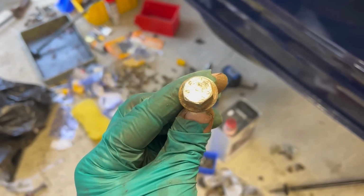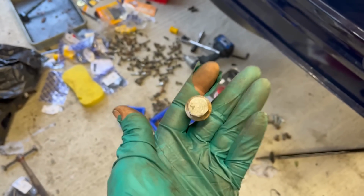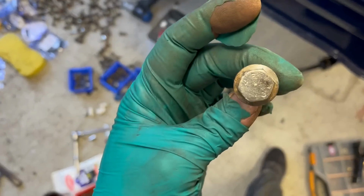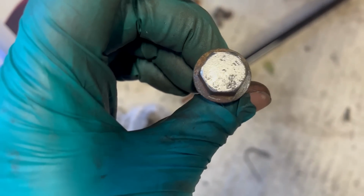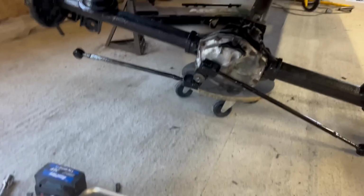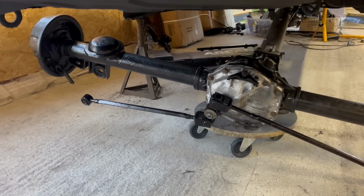Decision made. Unfortunately, I'm going to have to wait to get some correct bolts. Basically, this one, although it's not from that application, it's actually, what was that one for? I can't remember what it was for, but basically it is a trilobular locking bolt, same sort of type as that. Tap tight, I think they call them. And I've cleaned the head off, and it is a 10 point something or other. So basically, I think I need stronger bolts than the 8.8s that I have. So they're not going back in. I'm just going to have to wiggle the fuel tank up in there, and then when I get the right bolts, put the fork in afterwards and just hope I'm dexterous enough to get it up through there.